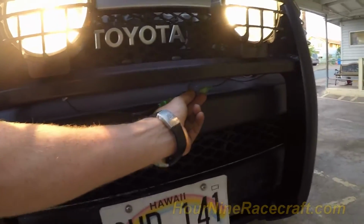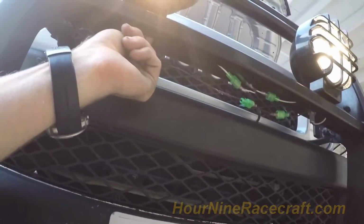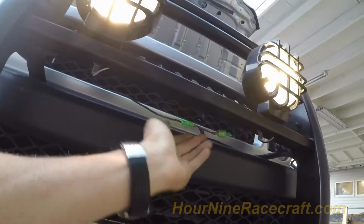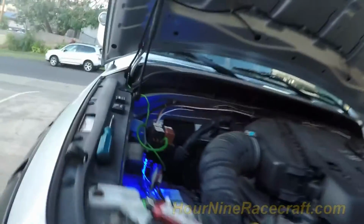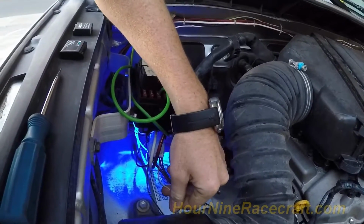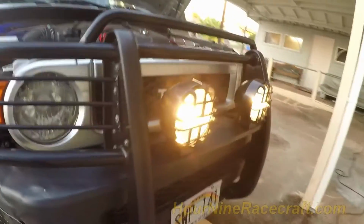What I'm doing right now is going around and feeling the smallest diameter wires to see if there's any heat. Wherever the smallest part of the wire is, most likely is where any heat would develop. None of them are even starting to get warm yet. This wire size is the same diameter as where it's going into the lights.